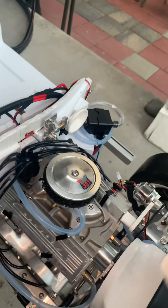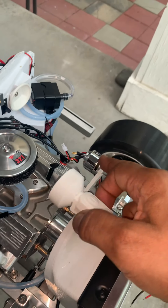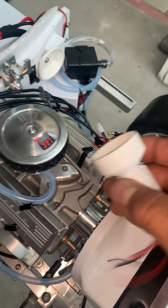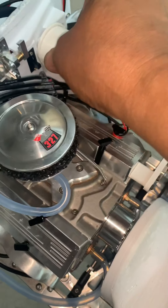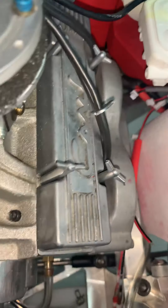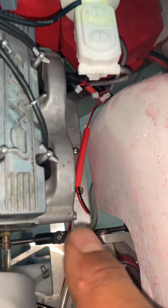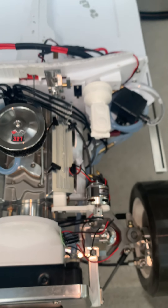Along with having this piece here milled from the shop and the water pump cover milled, this bracket is holding the alternator. The alternator produces AC — alternating current — and I've taken a rectifier circuit and hidden it inside this brake booster right here. I run the wires to it, and you see I have what looks like brake lines coming out — in actuality those are the wires that will connect this rectifier circuit to the alternator once it's installed.